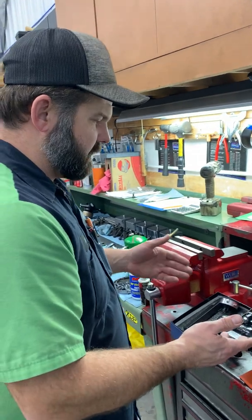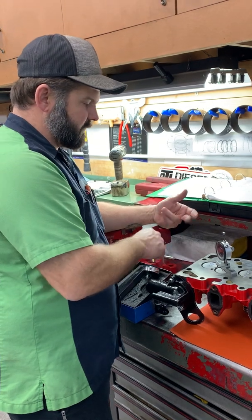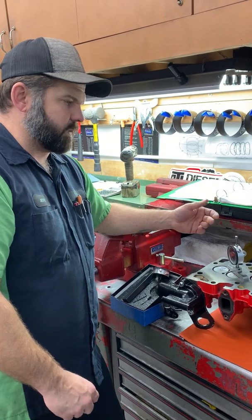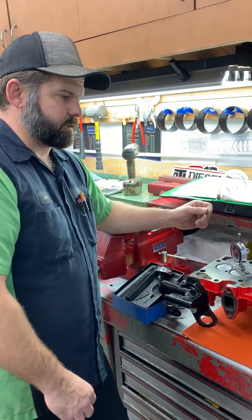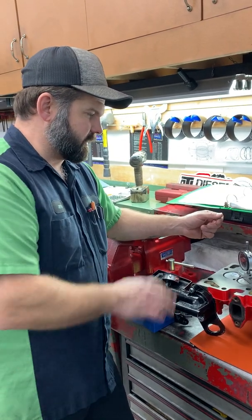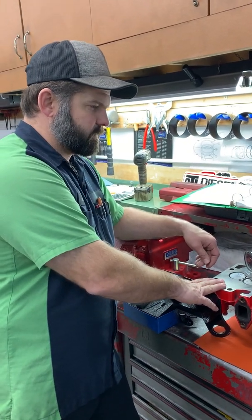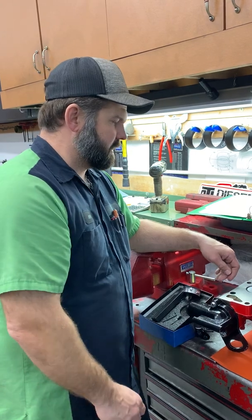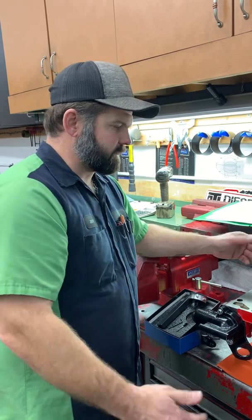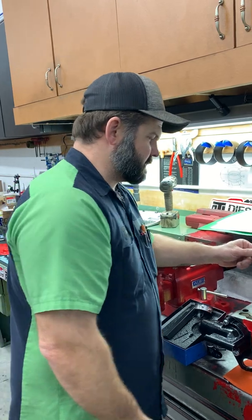And then while we're set up right here, we want to show you the cylinder head. Valve recession is very critical to valve to piston clearance. Depending on what machine shop you're using, if they're not well versed in diesels, they'll probably just go off of their rebuild spec. So there could be a 50 thousandths range on valve recession. So it's very important that you check it. We do a minimum of 55 on our 12 valves. We try to get all of them right at 55, but a minimum of 55. And we've seen a lot of times where an automotive gas machine shop did a head for somebody, maybe had 38 or low 40s, and they had issues.